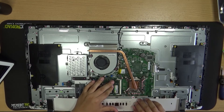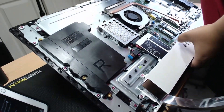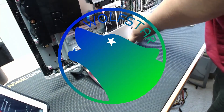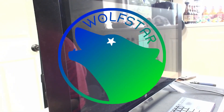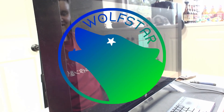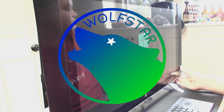After double checking that everything is secure, we're ready to do a test boot and install an operating system onto our new hard drive. To reassemble the computer, put the metal panel back on and replace the six screws we removed earlier. Put the rear plastic panel on, slide it into place, tighten the two screws on the underside again, and replace the rubber plugs we removed. This PC is very easy to work on, and it makes me happy to see an all-in-one with hassle-free hardware. Thanks for watching.